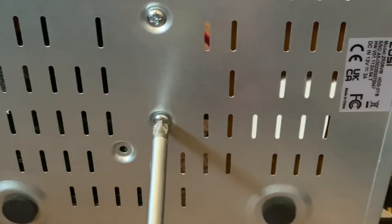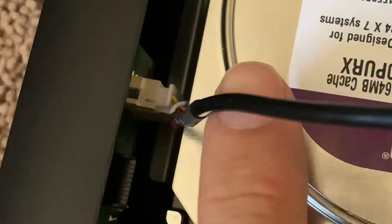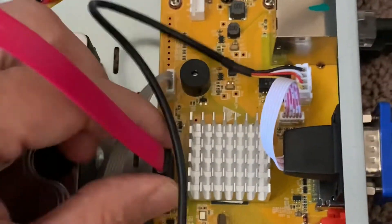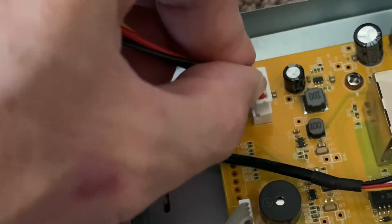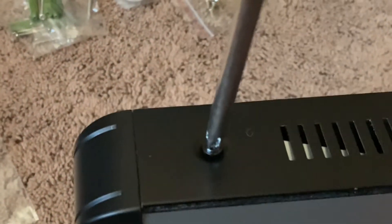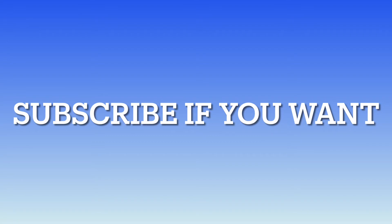You might have a little difficulty fitting the hard drive inside because different manufacturers use different layouts. Just fit it in — there are options to mount it vertically or horizontally. Line up the holes and screw it in. Then plug the power cable and data cable back in, close the lid, and screw it back. That's that simple! Please subscribe if you like this.